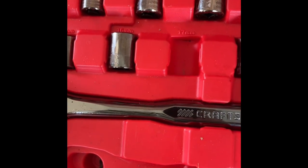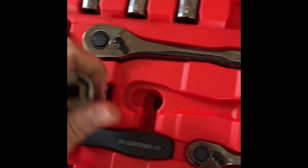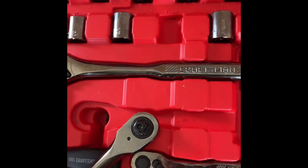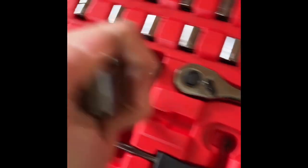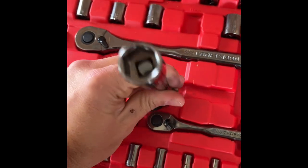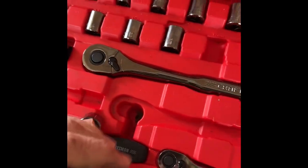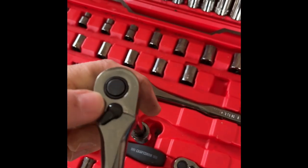Just check and make sure they're in the right place — yep, that's the 17-millimeter. This is a Japanese car so everything's metric on it. I don't think you need an extension for this one, but better to have it. I'll put the socket on the extension and attach the extension to the ratchet. Check which way it's spinning — right now it's tightening — so I'll flip my ratchet to loosen. Lefty Lucy, all right, we're ready to go.